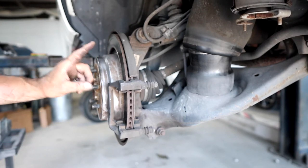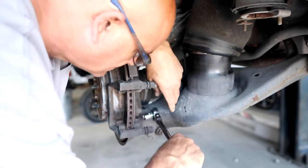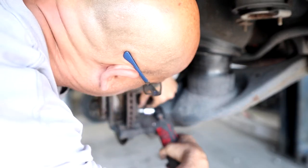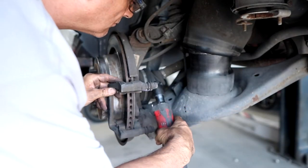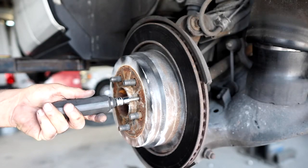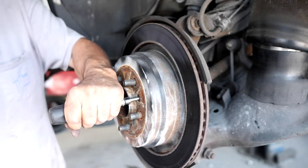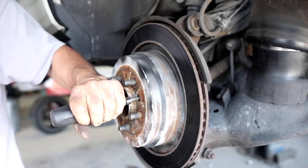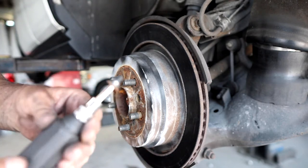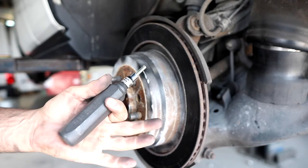In order to get this rotor off, you've got to remove the caliper bracket, which is held on with 16mm bolts. To finish taking the rotor off, there's an allen head bolt in here. It's good to have an impact driver — you push in and turn counterclockwise, then hit it one time with a hammer. Just like that. I'll put links in the description where you can get one if you don't have one. If you do brake jobs at home, that is a great tool to have.